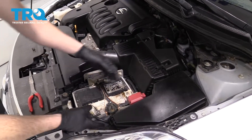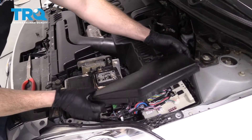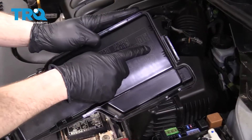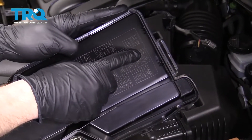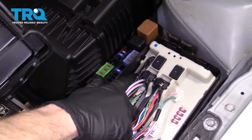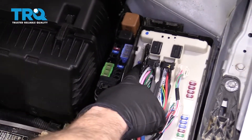To do that, it's fairly simple. You can come right over to your fuse box, just kind of pull up on this. You scan your little chart, find the one for the fuel pump. Looks like for this it's a 15 amp. So I would just look at this with my little treasure map here, find my top 15 amp fuse and remove that fuse.